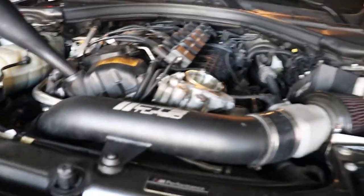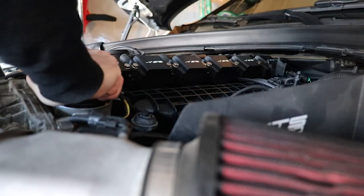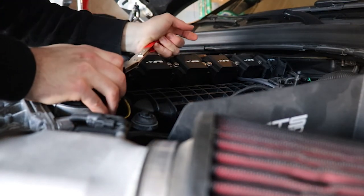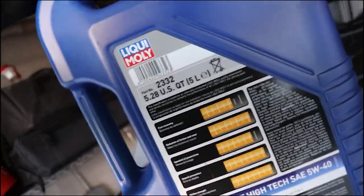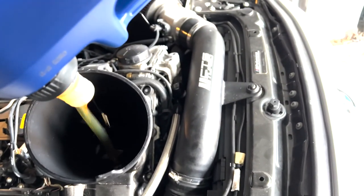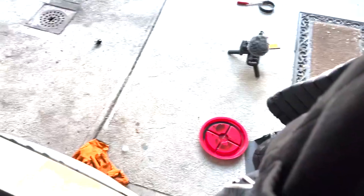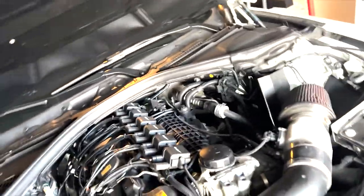We can close up the oil filter and start pouring oil in. Taking the gloves off since we have a funnel now and don't need to worry about getting oil everywhere. Oil filter is back on and now we're pouring in about seven liters of Liqui-Moly 5W-40. Look at the color of that old oil on the floor — you can tell we definitely needed this oil change. Seven liters later, oil cap goes back on and clicks into place, close the hood, and we're ready to go. Weights off the side, car's back on the ground.